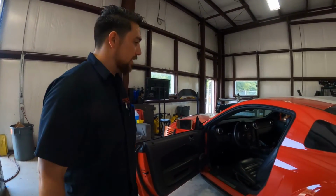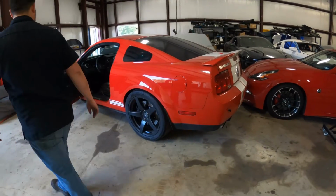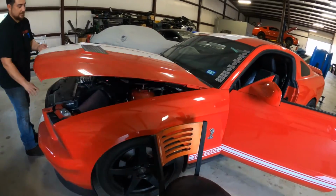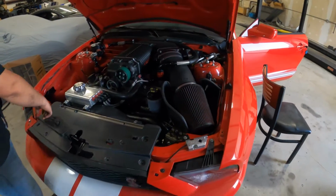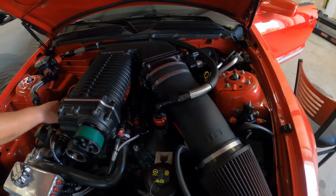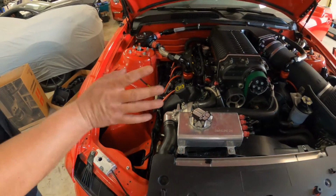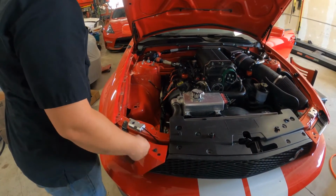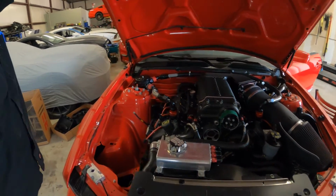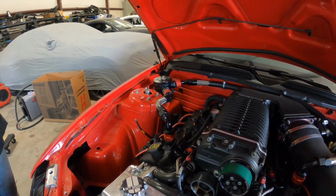This one made, I think, 1150, and then the head gasket wasn't very happy. We've got a 4.5 Whipple. You can see where that gasket went and blew the cap. But yeah, full MoTeC rewire, so you can see all the new electronics, all labeled, injectors and coils on the side. We make all the brackets and the entire MoTeC is made here. We buy all the hardware and build our own harnesses. Big breather catch can, so you get the full PCV system on its own system. That's huge, man. Dash 16 lines. I just put a little catch can.